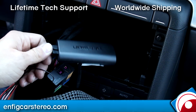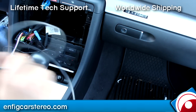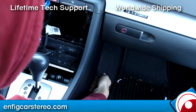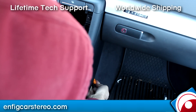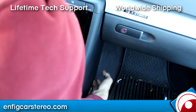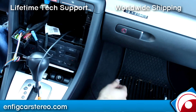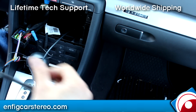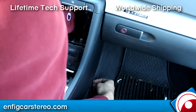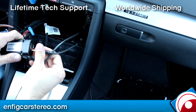Now we run the cables — let me zoom out to show you how to run them. This unit has both an iPod and an auxiliary connection. All you've got to do is grab the head of this cable, and over here where the carpet meets, just run your fingers in. When you put your fingers in here, you'll feel a little carpet which is the insulation. Stick your hand over on the other side, make sure it gets past the insulation, then push up. It goes up just like that. I'm going to run the AUX cable right behind it too — no trick photography, look how easy it was. This goes here, and this goes here.